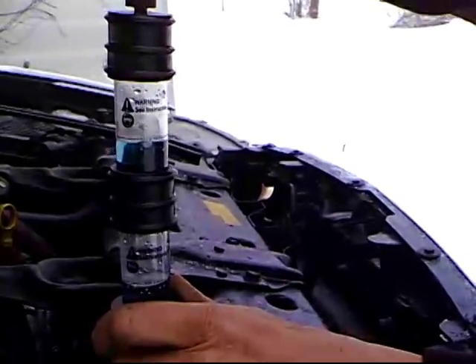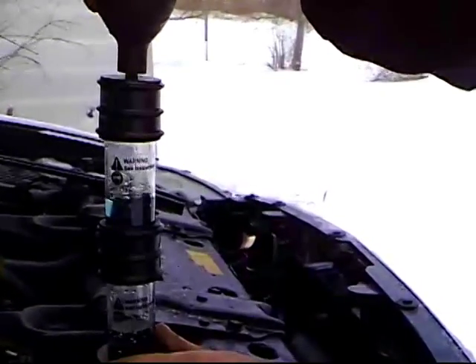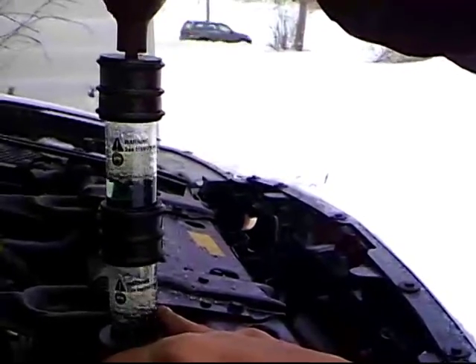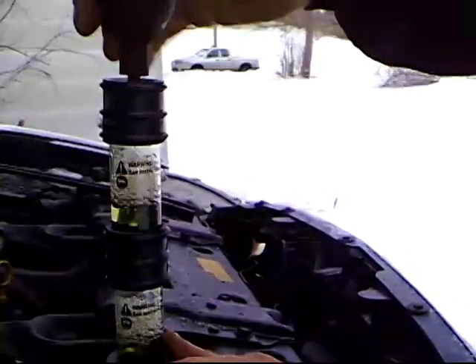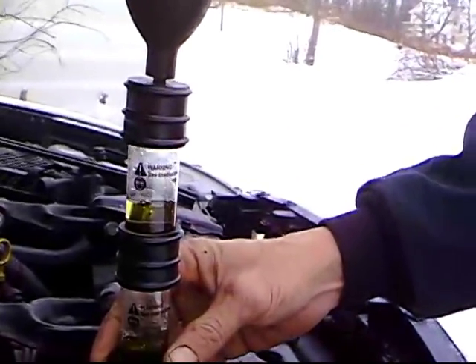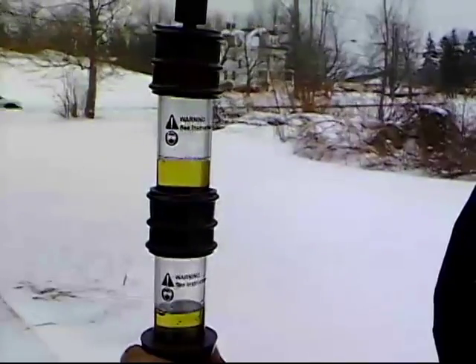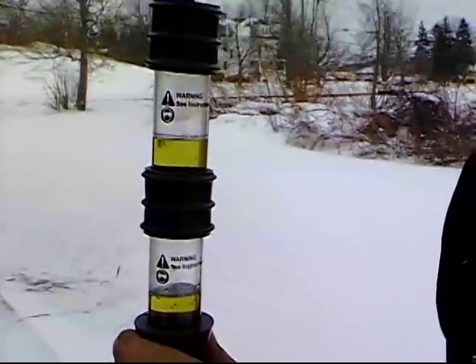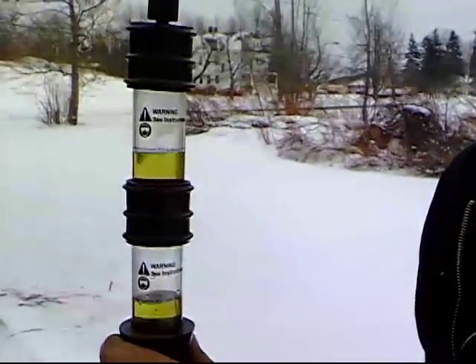Squeeze the bubble to push air into the system. We're going to suck some air back up from the cooling system. You can already see it turning yellow. There's your yellow fluid — it was blue when we started. That's an indication of expelled carbon monoxide gases in your cooling system from your cylinder.